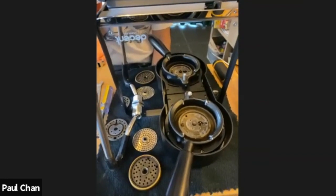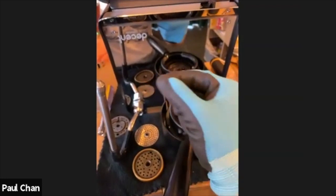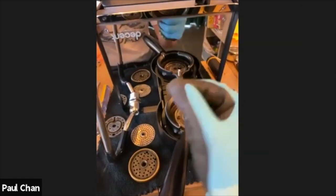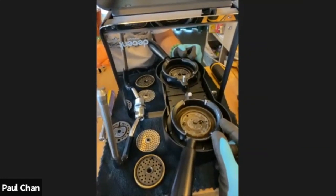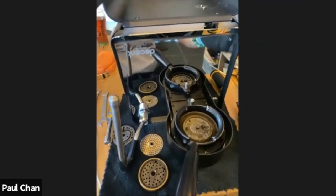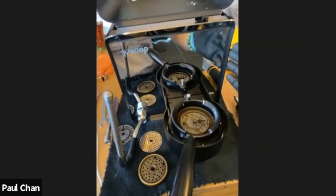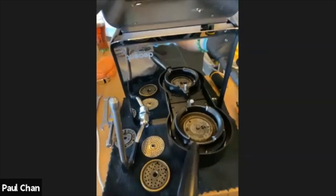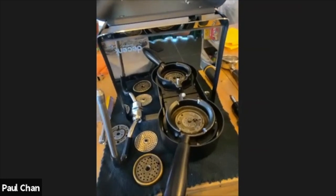It's kind of necessary to make sure it doesn't leak. We wiggle it into the port or insert it manually with a screwdriver first before we put the pipe in. And that test is just to make sure that that O-ring is doing its job. And it will save you some time, because if you've opened up your case, you've taken off the T10 screws, it will save you putting back the case and then finding out you have to do the job again. So it is more just double check you've fitted everything properly.